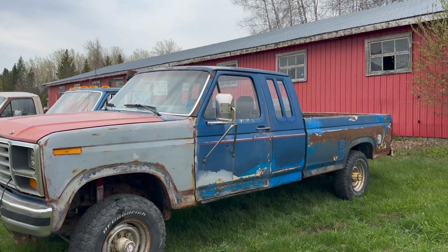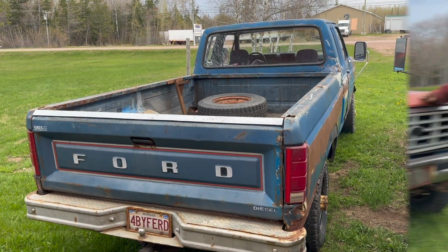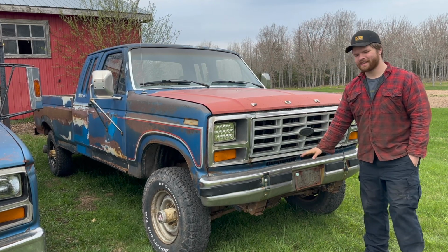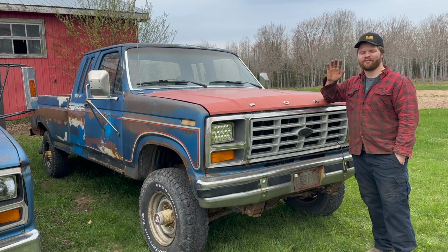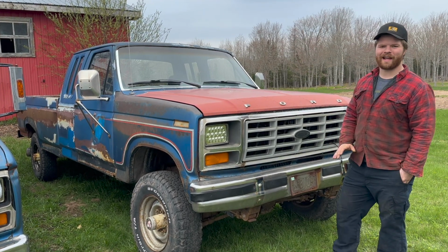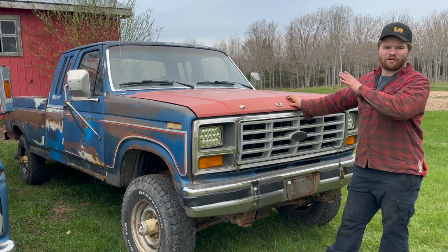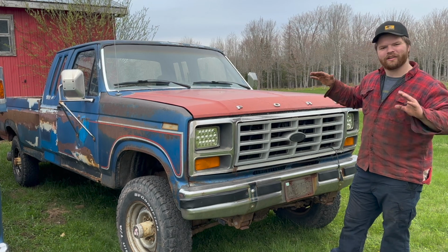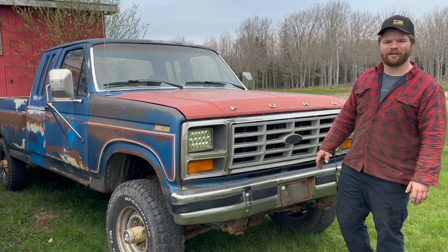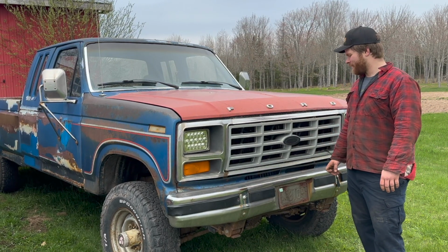There's a little bit of the side view, a little bit of the long view there. There's a little bit of the back view. This truck here has a few modifications to it to help it along. It has a Sky Manufacturing 2.5-inch front level and reverse shackle kit on the front that I slimmed down to basically be 1.5-inch only level because I want to raise up the back a little bit. I don't really like the flat. I just wanted to raise up a little bit so we wouldn't rub on 36x9-inch military tires that this fella used to have when we had it originally.